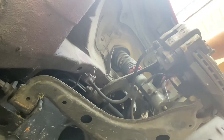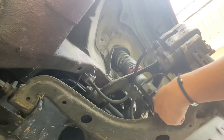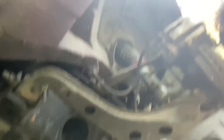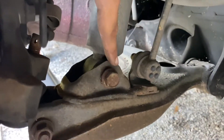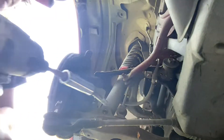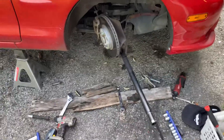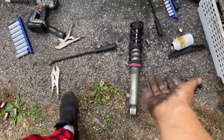I'm pretty sure whoever did this did it backwards because this bolt will not come out now — as soon as it comes off, it'll hit the inner tie rod. Outer tie rod is out. Now I can take out this shock bolt. Well, there it is. Going to put anti-seize on it. Finally got it out.